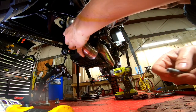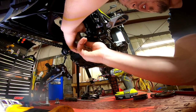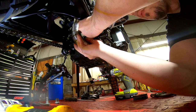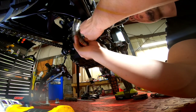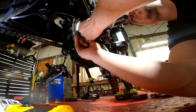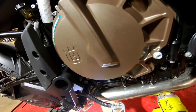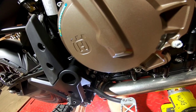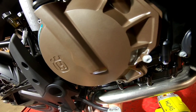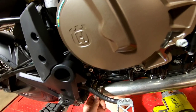The Aero will use the lower left-hand side bolt behind the kickstand. Line up the bolt hole and thread in the bolt — leave it loose so you have some play in the mid-pipe. Remember to make sure you put the exhaust gaskets on the mid-pipe on each end where it will connect. You can start putting your lower exhaust clamp on. Remember it has to be in the same orientation it was originally so you can get the skid plate back on — the bolt must be going in from the bottom upwards.